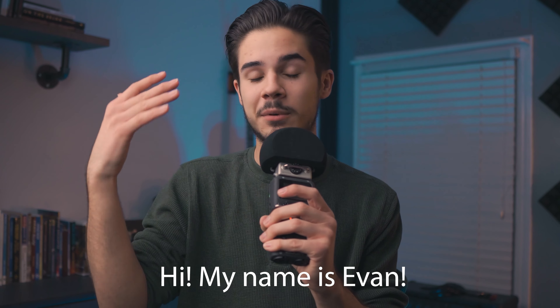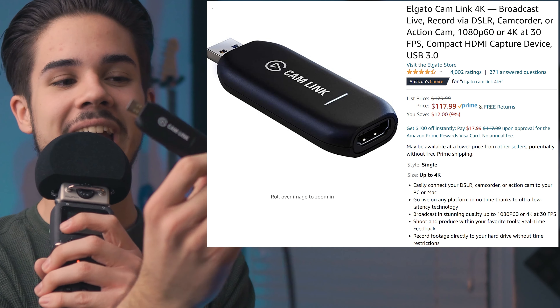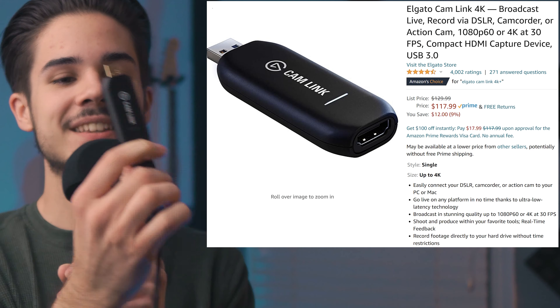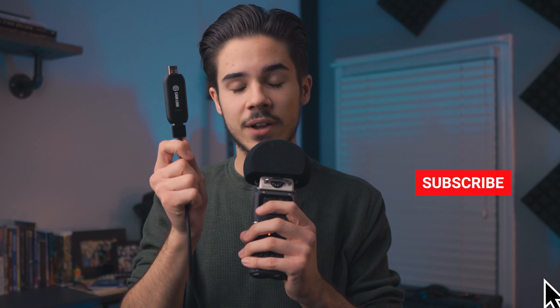If you want to connect a DSLR or professional camera like the Sony A6400, you need a capture card to direct it to the computer. I'm going to talk about the Elgato Cam Link 4K — this thing is awesome. I use it literally weekly for our live streams. You do an HDMI connection to the camera and then it goes into the computer via USB. It also allows for audio to go through it, so if you want to connect an audio source to your camera, it can go through the Elgato Cam Link.